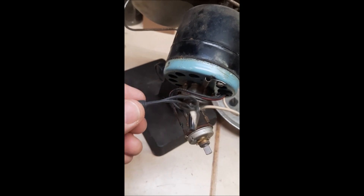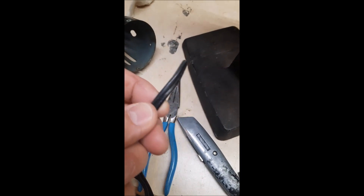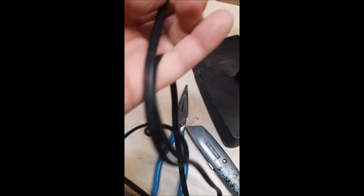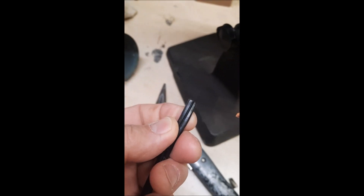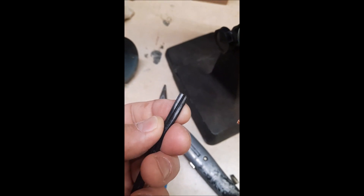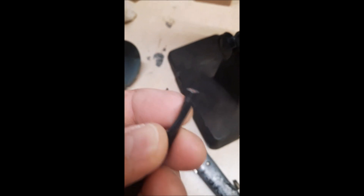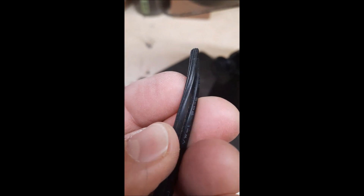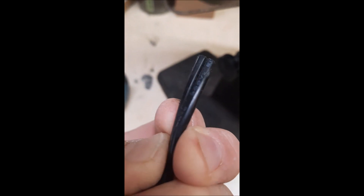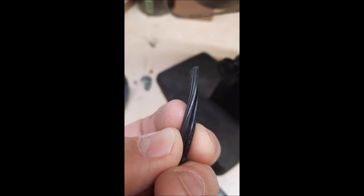When you wire your new wire, you want to be sure to follow the same orientation. I got it all disconnected. I have this appliance cord salvaged from an appliance we couldn't repair — I saved the cord, it's in good shape. You'll notice the outside of the cord has a ribbed side and a smooth side, so you want to be sure to hook them up the same way as they came off.